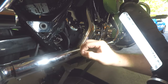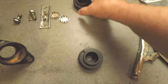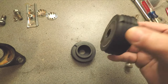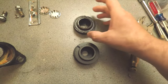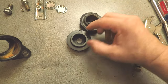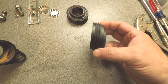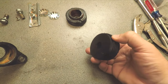Make sure it all looks good. This is the new bushing — as you can see it looks really good — and here's the old one. The old one has some cracks in it. It's hard to tell if it's bad, but there are some cracks in the rubber. I can almost guarantee that with 67,000 miles on this bike, it's a good idea to replace these. I mean, this is just a hard type of rubber.